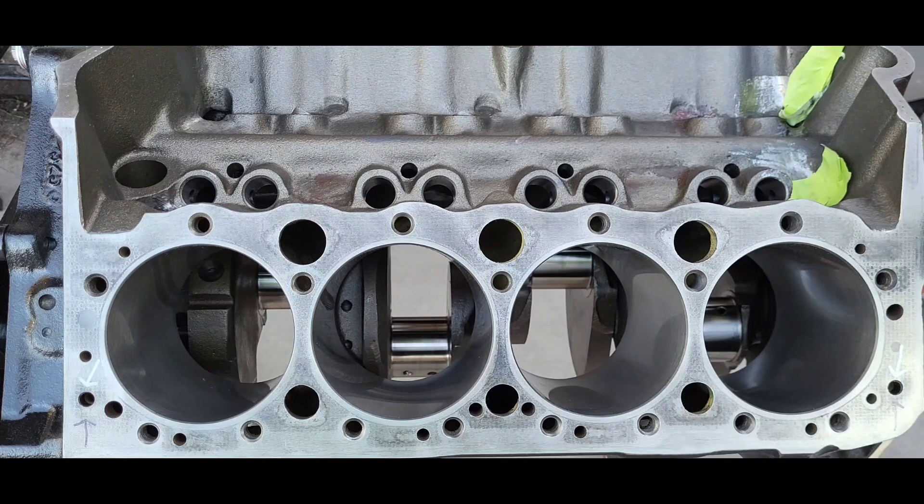If you're over 0.8435, you can rebore the lifter holes for oversize lifters which are 0.875 — you don't have to throw away your block. My cam bearing clearance was 0.0025, two and a half thou on the high side, but tolerable.